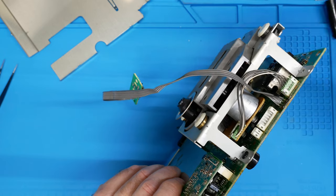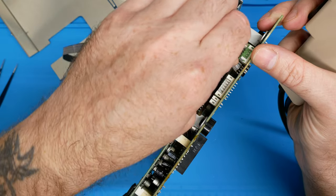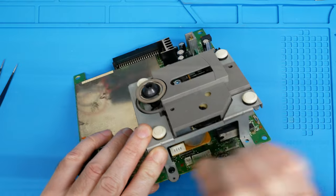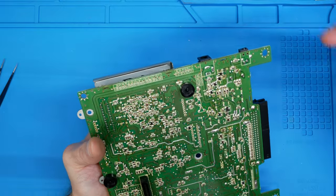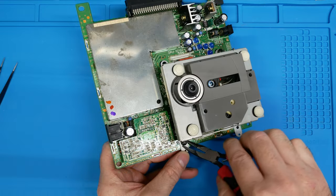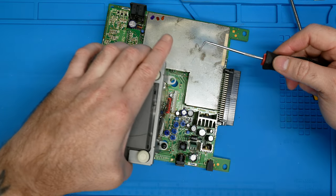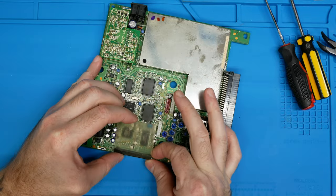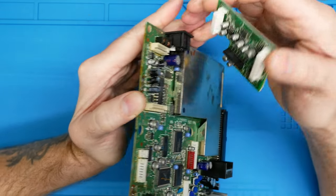Here I'm marking the ribbon cable and the connector so I make sure it gets on correctly. I decided to remove it so it wasn't flopping around and breaking. With that out of the way, I started unplugging the optical drive assembly. You'll need to remove these two fasteners — just push in that center pin with something hard; I used my fingernail. Once pushed in from the bottom, you can remove them from the top pretty easily. Then I'm removing the connectors using a pick tool, and the whole optical drive assembly pops off. It's pretty crazy how beefy this thing is — heavy-grade stamped steel. Remove that little protector. Here's your sister board with a lot of capacitors crammed in there.